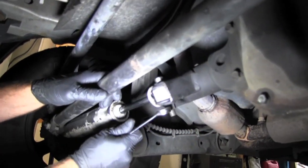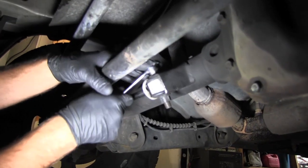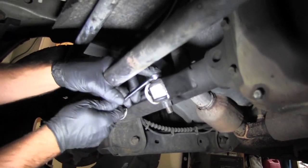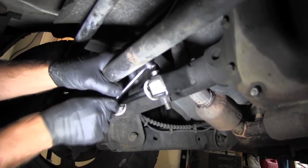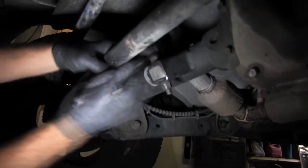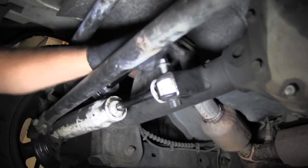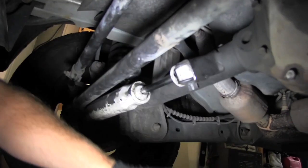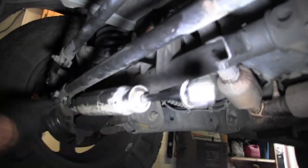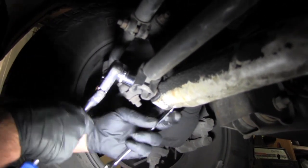So this nut's welded on. Don't try to take this one loose. It's gonna stay there. You don't even have to put anything on it. If it does turn, somebody's broke it loose before. So this bolt, it'll come out the top. Let's take her out here. You'll reuse this bolt. Most kits send you that other one. Here's your 17. Other side, 15.